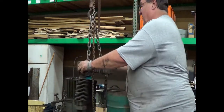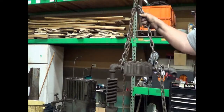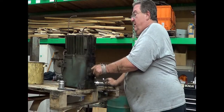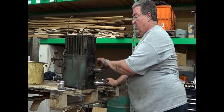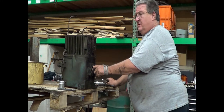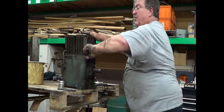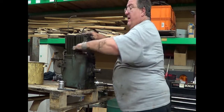Work smarter, not harder. Put those in the parts washer. Next step we're going to loosen the cylinder bolts, then we'll spin it around so the camera can see. We're also going to take our connecting rods loose in the bottom — there are six bolts around the bottom connecting the cylinder wall to the crankcase.